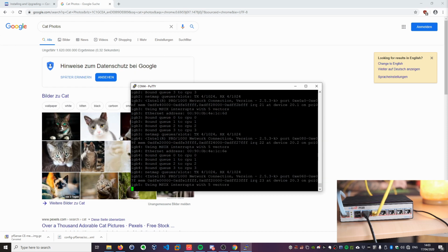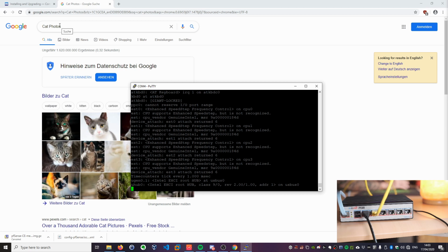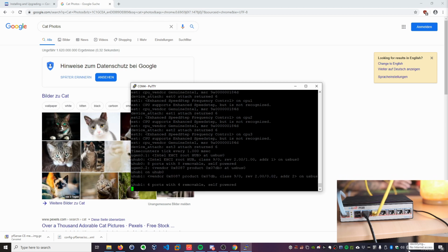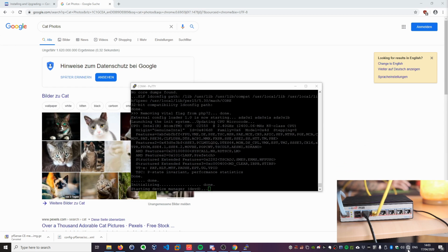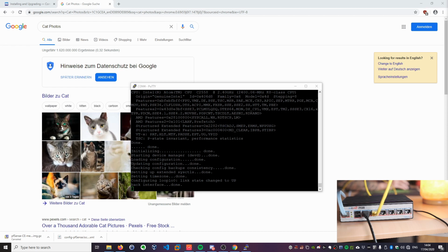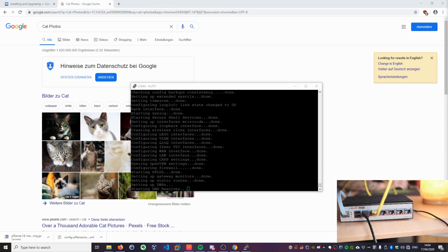And I've re-recorded this video just now because I made a mistake while doing it. That's why you see cat photos there. What I want to show you with that is I actually plugged the yellow cable into my computer now, which is connected to the pfSense LAN interface. And as you can see now, we don't have an internet connection yet, but we will in a second once that is fired up. And the reason why that is already working is because I have plugged in the black cable, if you remember, into my switch where my actual network is residing.